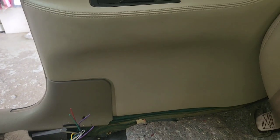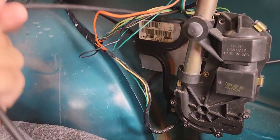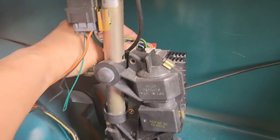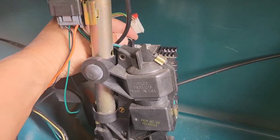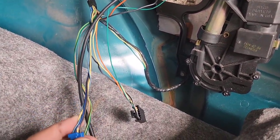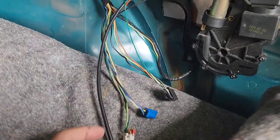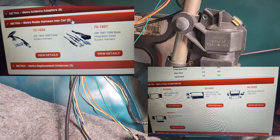It should bypass and go all the way to the back. On the right-hand side — this is what happened — this is for the antenna. Somebody either got mad and cut everything, cut that wire from over there to here. This is where the amp is, and this is where the speakers connect. You can see light blue, yellow, black, yellow, brown, and blue — that's for the back — and tan, gray, light green, and dark green — that's for the front.